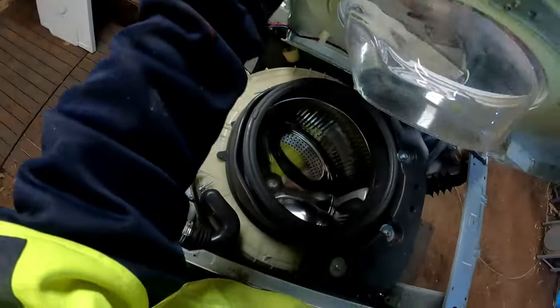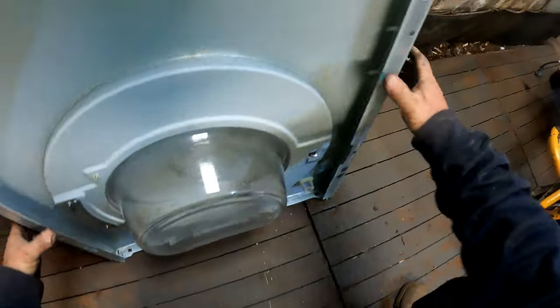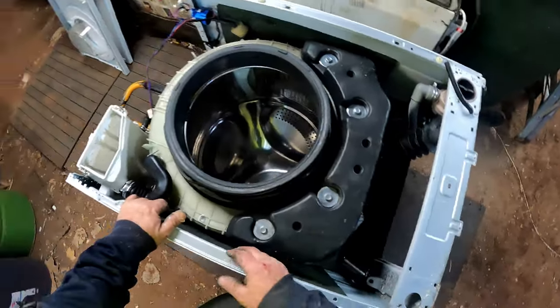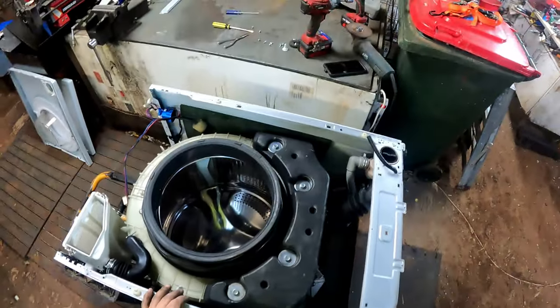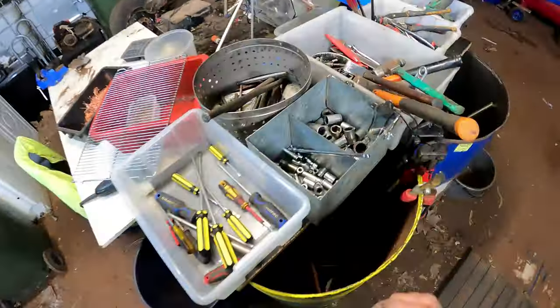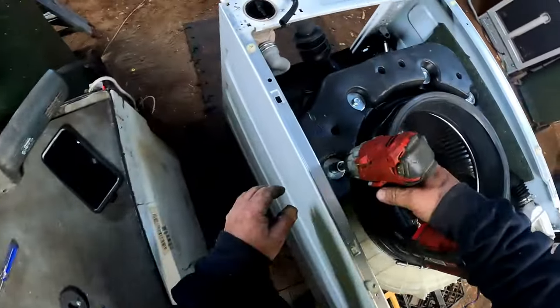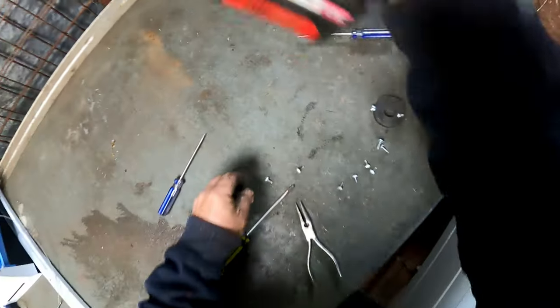What's still hanging on to that? There's the door wire. Pull that out of the road - sit it upside down. Like I said, we're going to have a lot of parts. I don't need to remove the door, but I will take the balance brick out - that's what they're called. They're there so when your machine is vibrating like crazy, they stabilise it - that's why they've got concrete in them. I need a 13mm for that.